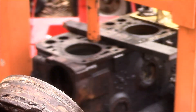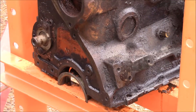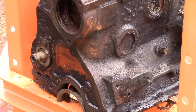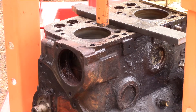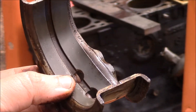I'm going to clean up that cylinder and run a hone through it — not a reamer — to see what it looks like. I also nicked the side of the cylinder with that piece of metal. Somewhat disappointed with myself; I gotta be more careful on the rest. I also hit that bearing — I wasn't going to reuse it anyway, but I'll need to check for damage at the bottom end. I think it'll just hammer back into shape... I'm joking.